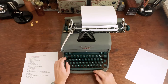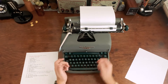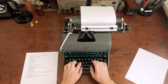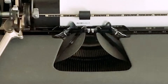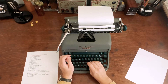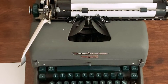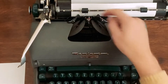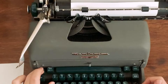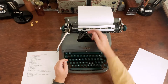The next difference is that backspace is literally just back a space. You type something out, hit backspace, and it literally just moves back a space — if you want, you can type something different over that, and you end up with letters stacked like a double exposure on film. Also, make sure you're only hitting one key at a time. If you overlap keys, you'll end up with two of them stuck. This typewriter has a key marked KR — key release — push that and it'll unjam them. On every other typewriter you just have to do it with your fingers.